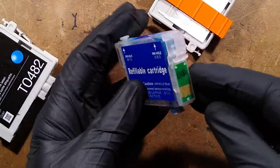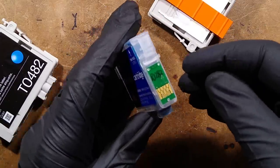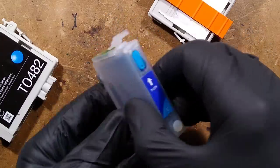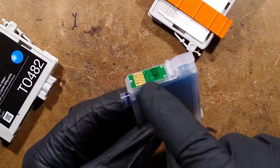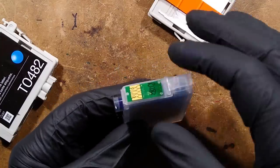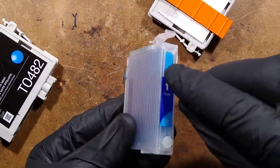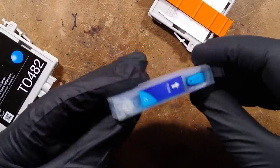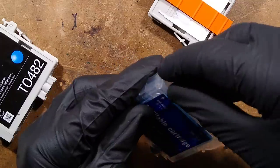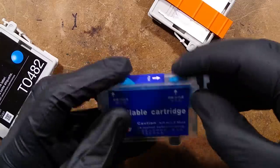The other option you have is the refillable cartridge, as I mentioned. This one has a tiny little battery in the back of it, a little lithium cell, I think. And it's got a little microcontroller, I'd guess. I think this is the type that, if the printer's on and you unplug it from the printer while it's on and then plug it back in again, it can detect that and automatically revert itself to zero. I don't know if it has a separate memory chip that it writes to, or if it's all done by the microcontroller just pretending it's the memory chip. In this case, you've got a little air bung that comes out here and a fill port here that you can squirt the ink in to fill it up to your desired level, and it's translucent to let you see that. Then I think you put it into the printer and then remove the air bung. This was just for storage and when you were actually filling it.